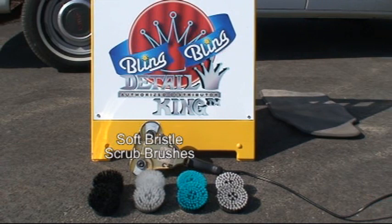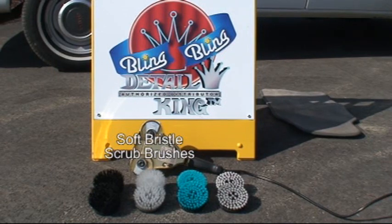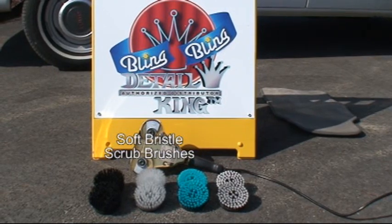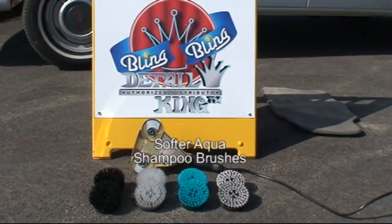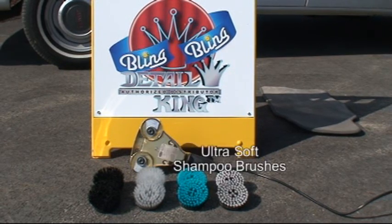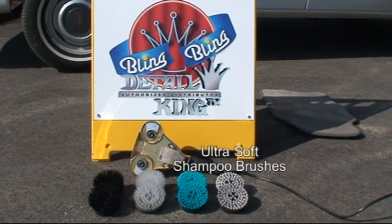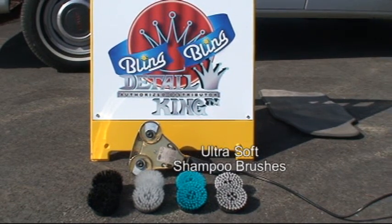The white bristles are used for carpet shampooing, mats, cargo areas of SUVs. Can also scrub convertible tops with the white scrub brushes. The softer aqua shampoo brushes are used for shampooing delicate carpets. And finally, the gray scrub brushes, the ultra soft ones, are used to help scrub fabric seats like velour upholstery.